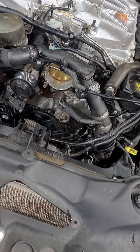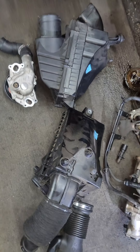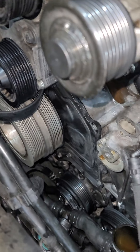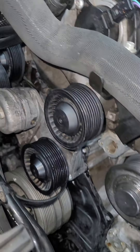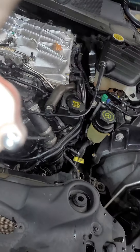It's very easy — you just need to take off the air box right here, both of them. It's an 8mm bolt on this one and this one too. Remove all three, disconnect it, and take the air box out to have some room. Once you take it out you'll see this, and then you remove the serpentine belt and the other belt, which is the AC belt. Then it's just four bolts for the water pump — I think that's T30.